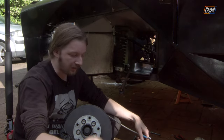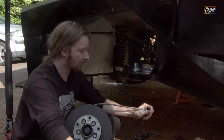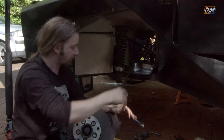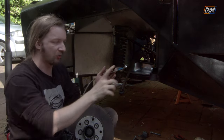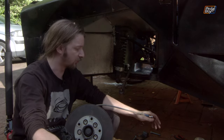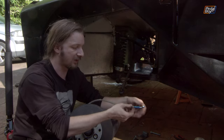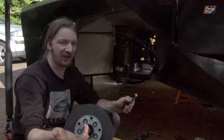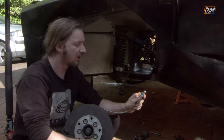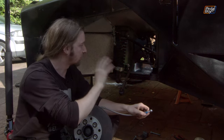About three hours ago I mentioned getting our front brake lines attached, which is why I wasn't putting the wheel on. We got a little carried away trying to figure out where to route it — tested a whole bunch of different arrangements, swapped the ends because the two banjo ends are slightly different — and came up with what seemed like a fairly decent solution. Unfortunately when we went to put the bits together the fittings don't quite work: we've got an M10 here, a coarse thread there, and no two parts solve everything, so we were going to have to order some bits anyway.